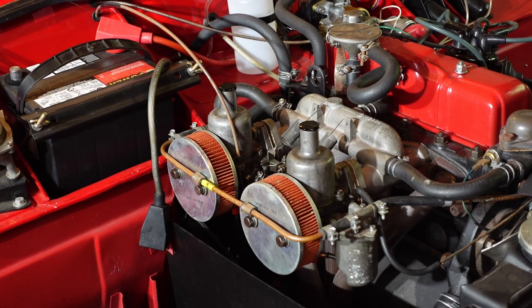A lot of the suggestions I got were about a fuel delivery problem. We're going to go ahead and check to see if there's something stuck in the carb or whatever. I don't think so, but we'll give it a shot. We'll pull the air filters off, pull the float bowl line off, and get into the top of those pistons and take a look around, see if I can figure something out.